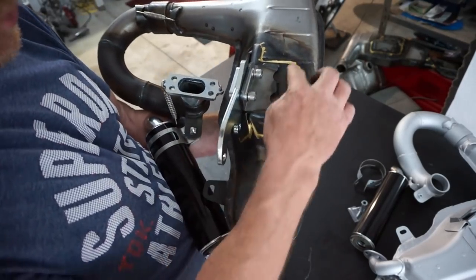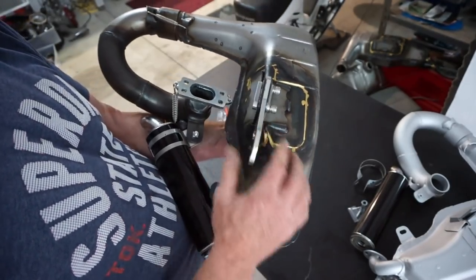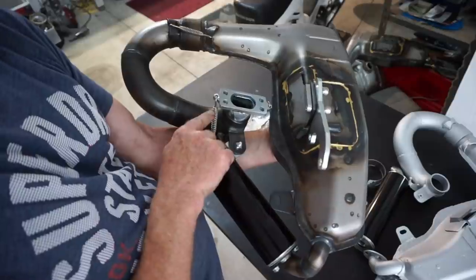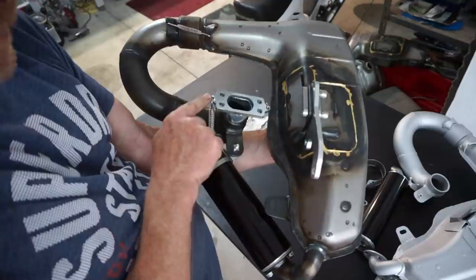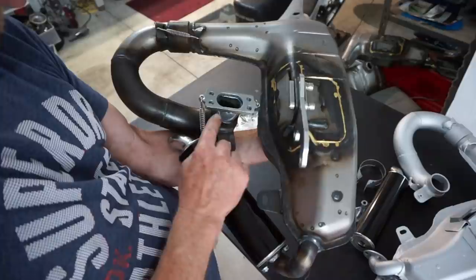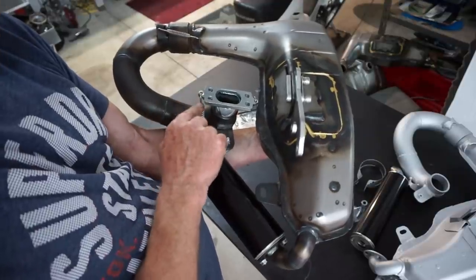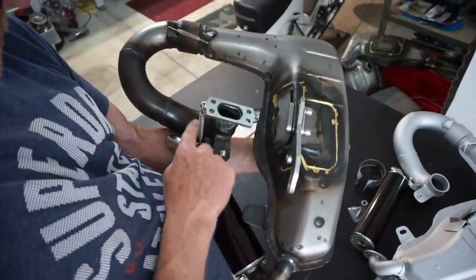As you can see, same sort of design with all the brazing on the brackets and everything. I've put this one together. The only thing I don't like is where the spring clips here fit on, right on the edge — both corners here, on the edge. This means you have to cut your cowling away, and I disagree with that. These springs should have been mounted under here, directly down, so you don't have to cut your cowling. That needs to be rectified by BGM.